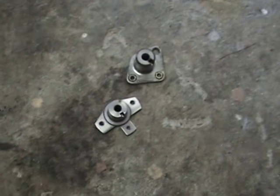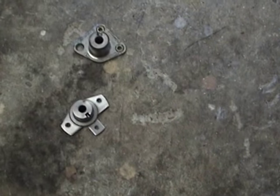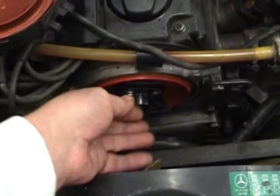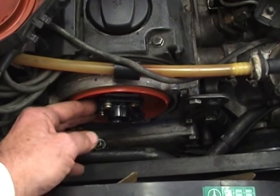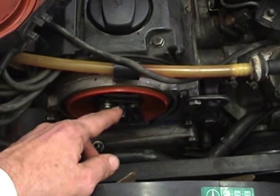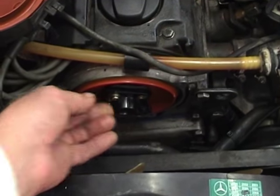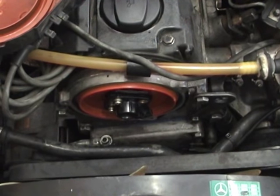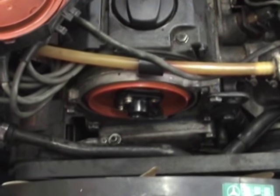No — I've been given the wrong part; the bolt won't go through the hole. So I have to put the old one back on. There are two different types of adapters for this rotor button from the camshaft: one is alloy, 22mm diameter, and the other is 20mm diameter in steel — and that's the one I got sent. I've been looking around and can't find one, so I'll have to put the car back together as is, order one in, and do it again.